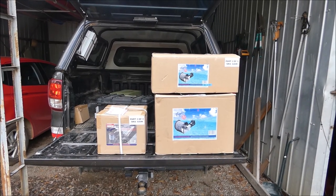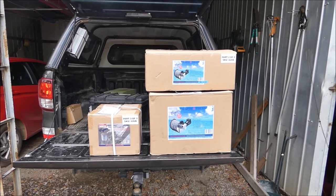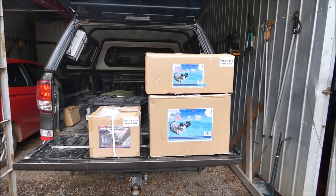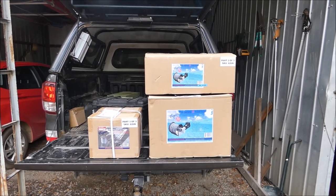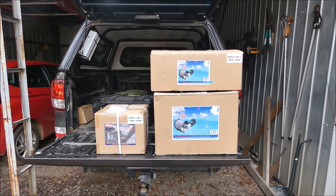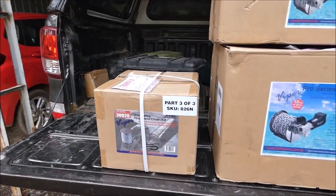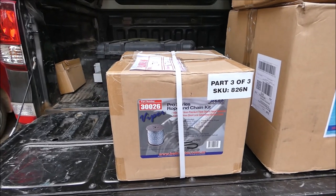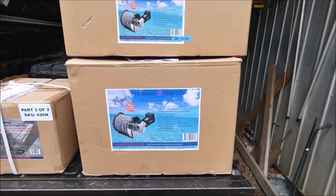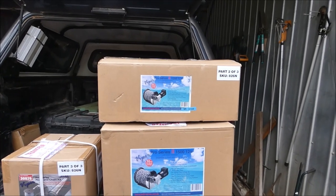This is my Viper Pro Series 2 1500 drum winch that we're going to be installing in the RL28. It's starting to get a bit hard to pull the anchor chain up so I figured it's time we got an anchor winch. The winch is one of the biggest ones you can get, suitable for 8 metres and upwards, and it can hold 100 metres of rope and 10 metres of chain which comes with the winch, although you can use your own of course. You have the big box that contains the drum itself and the smaller box that contains the motor and gearbox, which very simply bolts onto the side of the drum.